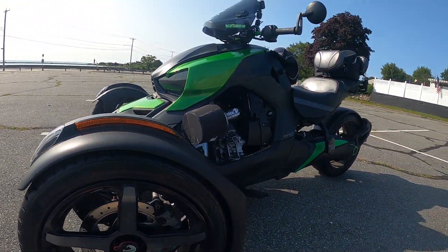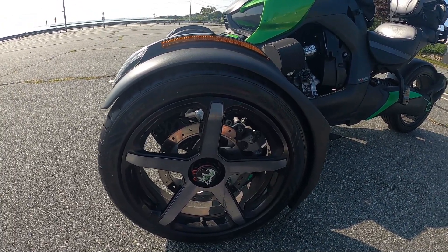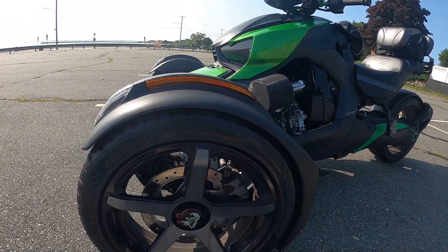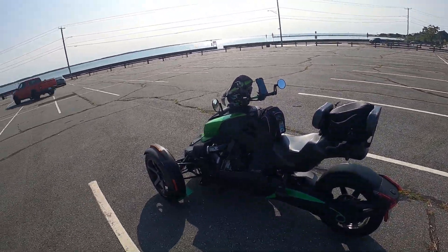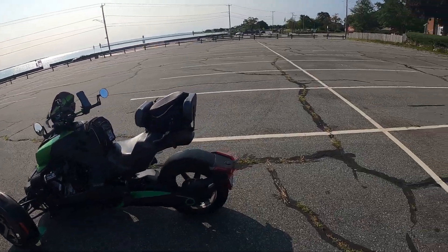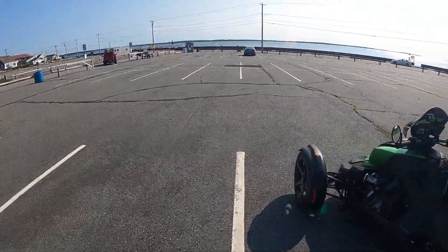The other biggest complaint, even in the form it's in now, are these puny little brakes. For the 600 and a stock 900 they're okay — these are single piston brakes and the rotor is fine — but there's not enough power in these calipers and this braking system to really stop this thing. I've tried; I've not been able to get the ABS to kick in and it just kind of cruises very slowly to a stop — not ideal at all.